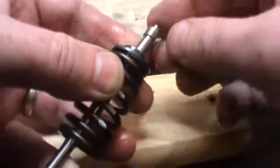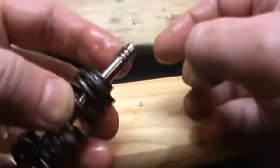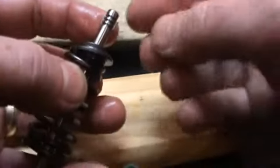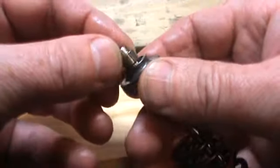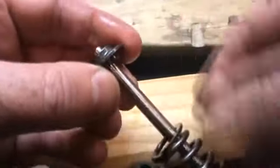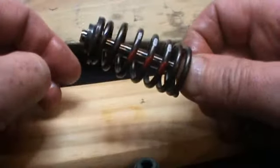Get one on, and the other one — let me get closer — you see the tip is going down. Put the other one on. So the big hole in the top hat slides over the collets, like that, and holds them in place. If I push the spring up against it — there you go, that's it, fully finished.